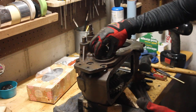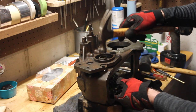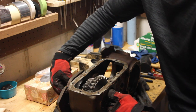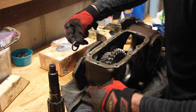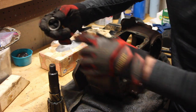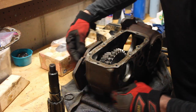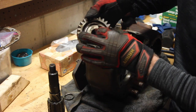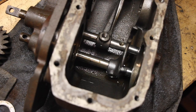I'm going to use the old pinion nut as a buffer and just hammer it through. It worked! Unscrew the nut - you could probably do it with a dead blow hammer. Pull the whole shaft out. The configuration from top down: there's a spacing washer with a beveled edge on both inner parts, so I don't think it's directionally oriented. The center gear has a spacer washer that's obviously thicker, a forward-facing bearing, and then you just lift it out.